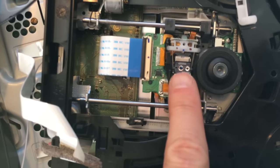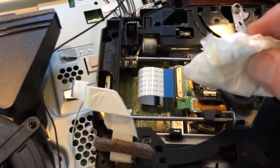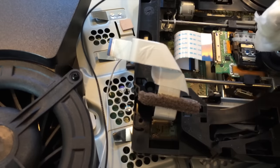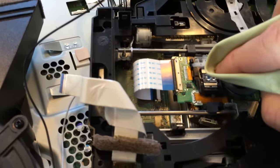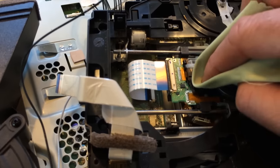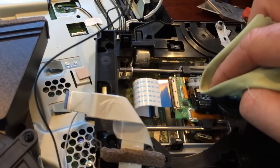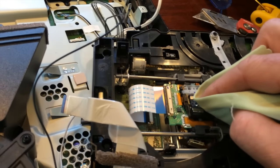And there's the little devil you want to clean — right there. So you just get some alcohol and a q-tip and away you go. I don't have a q-tip in the house it turns out, so I'm just going to use a Kleenex and get it moist. This is the only part in here you want to touch — you don't want to get anything else. And then I'm just going to get this lens cleaning cloth and just get it a little bit there. Really that's all there is to it. This should fix most of your reading errors and get you back playing games and watching Blu-rays and enjoying your PS3 again.